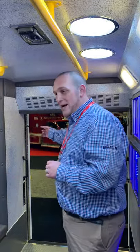The outside skins are 0.125-inch thick aluminum. All door skins on this truck are 0.190-inch thick — you can feel how solid they are. On the inside we use 0.090-inch aluminum throughout, all the same 5052-grade aluminum inside and out. We don't use two dissimilar type metals anywhere because that creates electrolysis and corrosion. We pre-punch and pre-engineer every hole, use grommets for lights, use coated bolts, and use anti-seize on every bolt to take every obstacle away so that truck lasts forever — built for life.